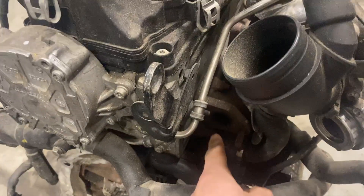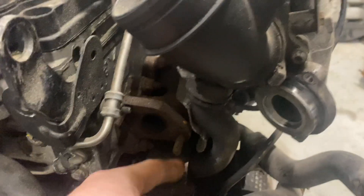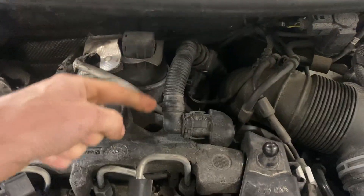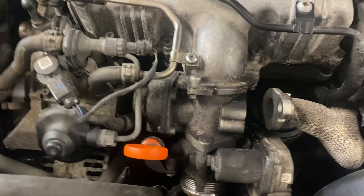Starting off, high pressure. It's considered high pressure because it's fed from the manifold before the turbo — it would feed into your manifold. So let's go to this car that still is intact. The turbo is back here. We have a steel pipe that basically does a U-shape over here, and then jumps in here at the EGR valve.